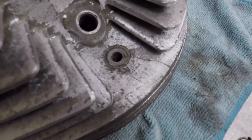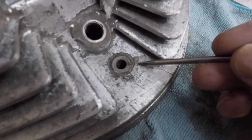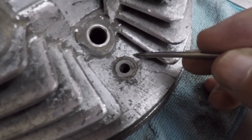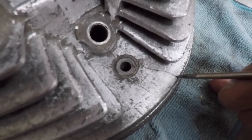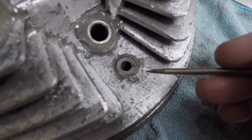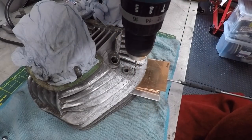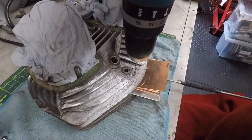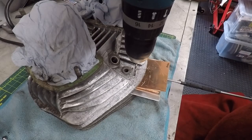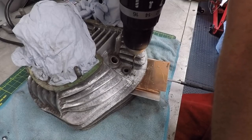So the plan being, obviously we're not going to buy a new cylinder head. I'm going to drill it at the end of that crack there. I'm probably going to drill it there, where them two cracks meet, that'll stop it tracking up that way. And I'm going to just V this out so I can get some of the Lumi weld that I've got left. Try and Lumi weld and repair it while it's in this state. That might not even be a crack there, but I don't want to take a chance, I'll do it anyway. Obviously not going to centre punch it, I'll shatter the thing.